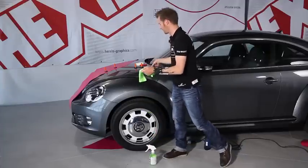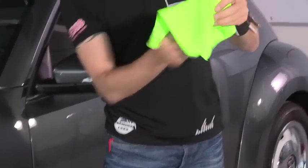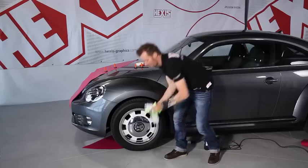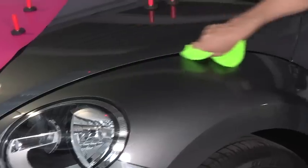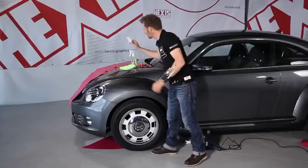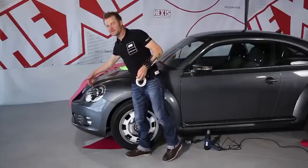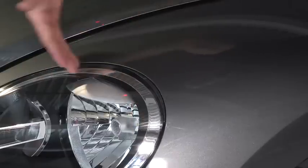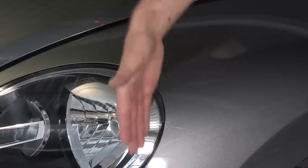What is important is to clean in particular the rims with the squeegee wrapped in a cloth, moistened with the liquid. Then, we take the tape and cover the rims of each component that we do not want to wrap, for example this headlight, to prevent the film from sticking on the rims of these components, which would later complicate the cuts.